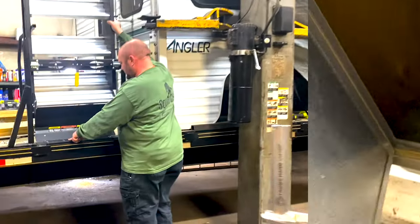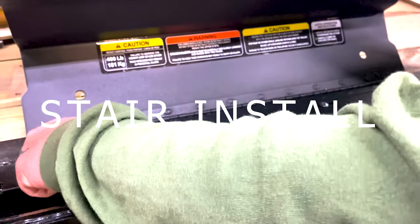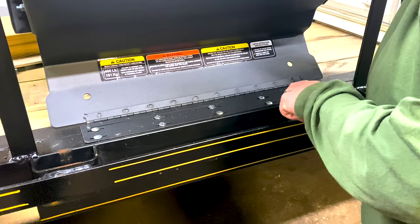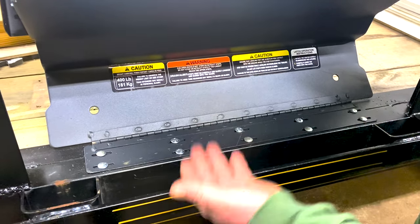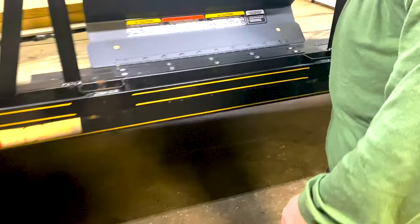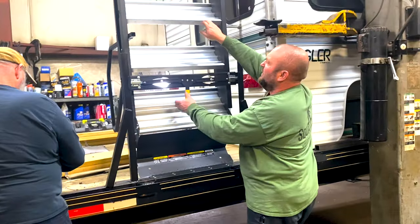So we got the box, that side, the little storage box, all cleaned out. So on to the next. We put a piece of flat steel under the back of it to support it, and welded it fast. And then all these go through the steel too, and it's got a plate like this piece that came with it on the bottom side. So it's sandwiching the board, trailer board and everything together. Doesn't move.